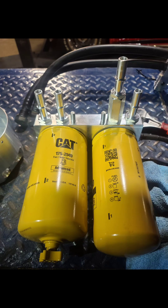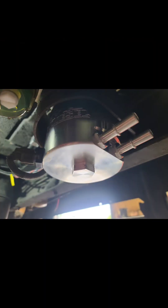First thing we're going to do is install the fittings and the mounting studs into the conversion kit filter head. As you can see, one of the fittings will get an extension on it; the rest of them it's just the fitting getting threaded into the filter head. These are o-ring threads — they don't require any tape, and there'll be supplied o-rings on all of the fittings.